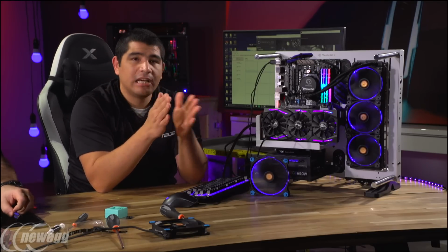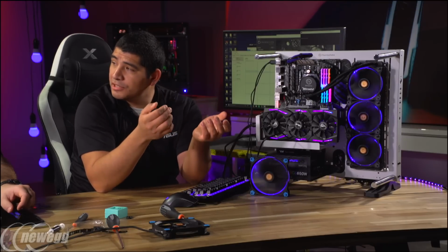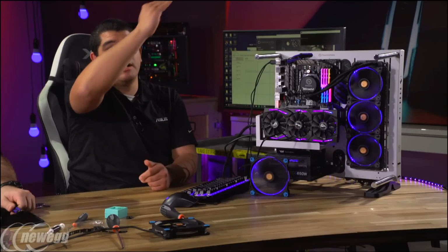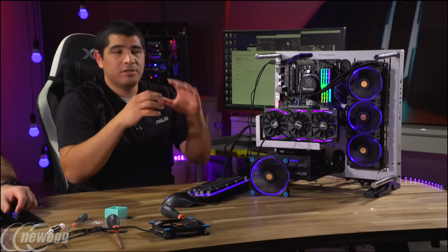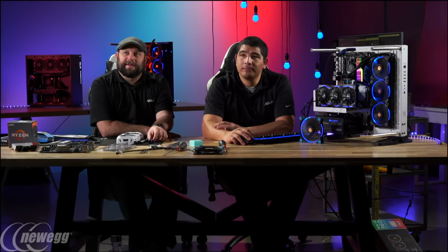And then ideally I would also use an offset voltage. I wouldn't use what's called a static voltage. That will also help to conserve life because the voltage essentially will come up and will come down. That's much healthier than keeping the voltage always at a really high level and having your CPU always be driven with that high level of voltage. But for 90% of users, you should just click the simple optimization, let the system do it.